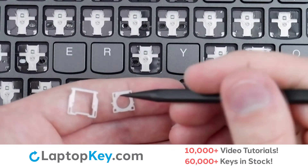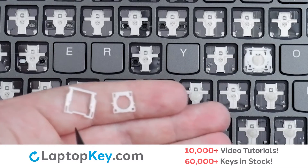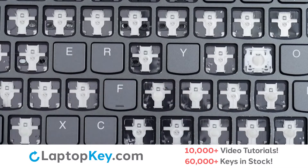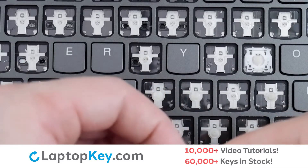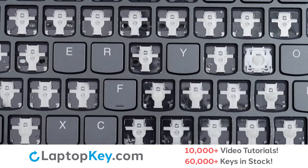To reassemble your clips, we'll begin with the top clip, which has two thin holes at the top and two smaller holes at the bottom. For the bottom clip, there's an upward facing notch and two thin holes at the bottom. Connect the two pieces together, making sure that the plastic support arms on the top go into the holes on the bottom.